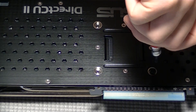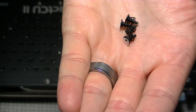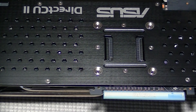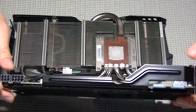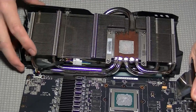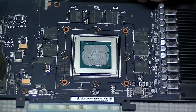If you've watched any of my other G10 installation videos, this is going to be pretty straightforward and very similar to any of the other generations of NVIDIA graphics cards. First, we just remove these four screws that hold the heatsink and cooler onto the GPU itself. These are the only four screws that actually hold the cooler onto the graphics card. Be careful that once you remove the cooler, you disconnect the fan from the fan header before you set the cooler aside.